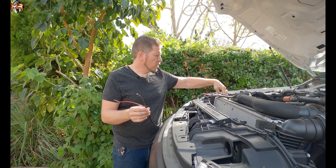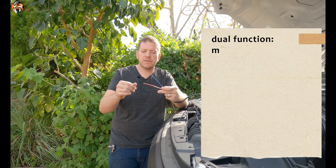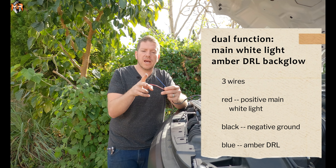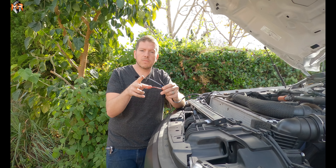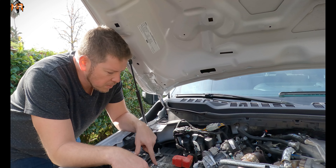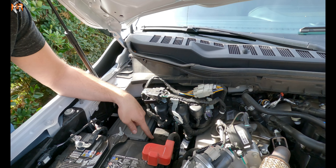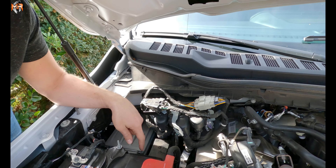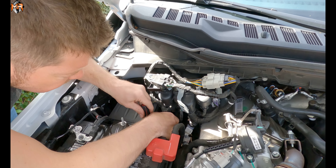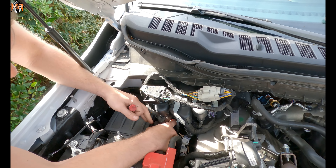If you purchased a dual function light bar, you're going to have three wires coming out of it. You have the red and black — positive and ground — but also one additional blue wire, which is the second function for a DRL. You'll need two switches to provide power because which wire receives power determines what turns on. On your passenger side next to the battery, there's an auxiliary box. To get to the auxiliary wires that are already pre-wired and hot, remove this box — there are two clips; use a flathead to pry it up and wiggle the box out.